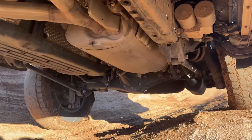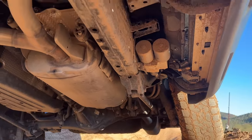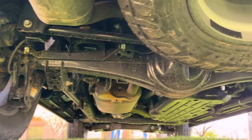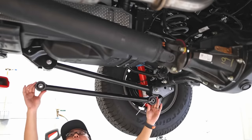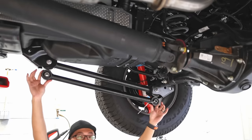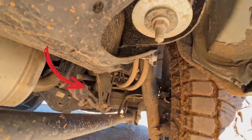This makes sense, as the new rear suspension didn't fundamentally change. Both old and new 5-link solid rear axles have very similar layouts. The new lower control arm actually has the exact same length as the previous generation, just a little beefier. Therefore, between the old and new GX, the increase in rear articulation mostly came from E-KDSS.